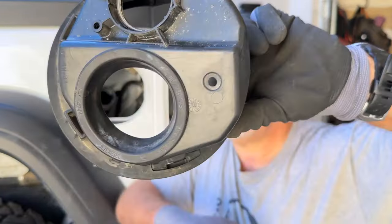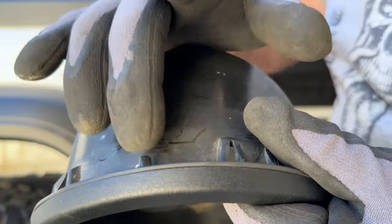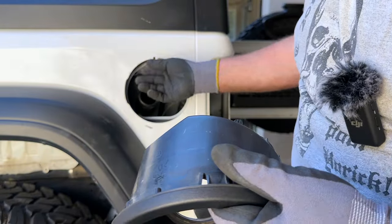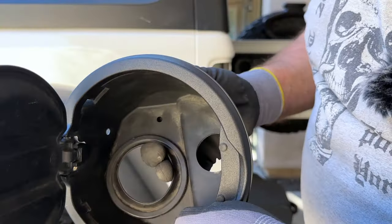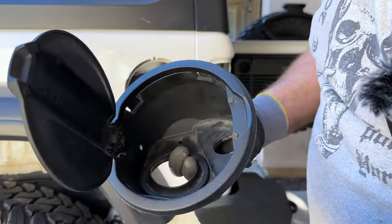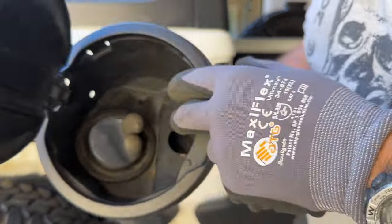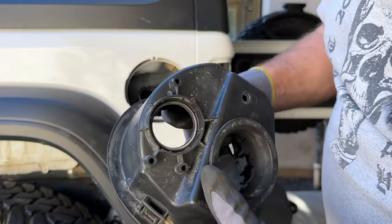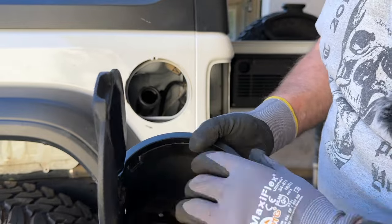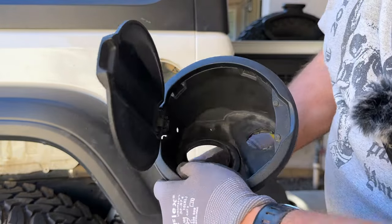Now it's time to get the fuel filler door back on. The fuel filler door gets this rubber ring — the flat parts go on the back. The fuel filler door has this little notch sticking up, and it goes into the notch on the vehicle right there, so it lines up perfectly. It's just plastic tabs holding it in all around. Hopefully these plastic tabs only have a useful life of so many removals. The DEF goes in this hole, diesel in this hole. On the back there are three screws that hold the DEF on, along with a bracket around the DEF line. Those screws are going to be a little harder to get in, but hopefully now I've got it tightened up and the door will go right on.